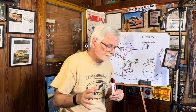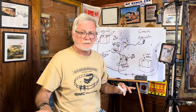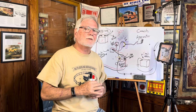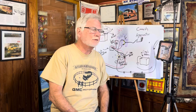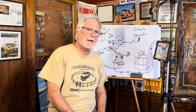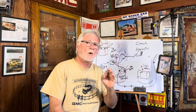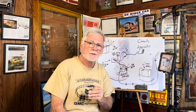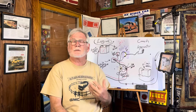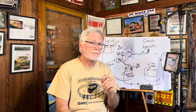When you're going to get your motor home, as a mission-critical system, you do not want to rely on the air ride delivery system in that coach until you've checked it out. You don't even want to use it. You don't know what this machine is. You say it's had good maintenance, but if something goes out, you are relying on their integrity. You need to rely on your own — on what you have in front of you, what you can see. Until you go through that system, completely cycle it, and look at the age of the compressor, the fittings, all that — to get it home, I would not use the air ride system.